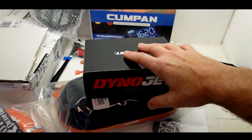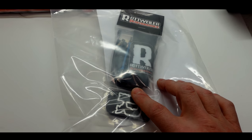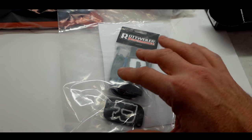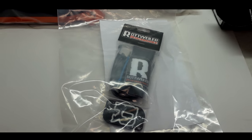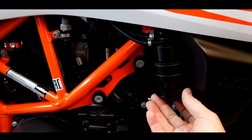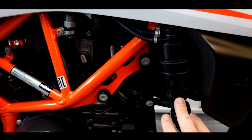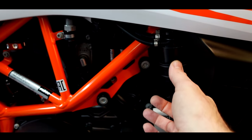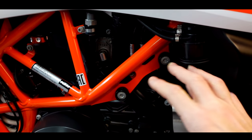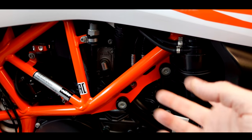Where we get extra air, we need extra fuel to compensate, so we've got a Dynojet PC5 to go on. As well as the Rotti intake, we've also got the Rottweiler air emission delete kit. Looking at the bike, it's got a huge catch tank — that whole system basically gets rid of all that junk: the tank and pipe work that feeds around the engine into the crankcase. All that gets binned off, saves a bit of weight, and it's just gone.